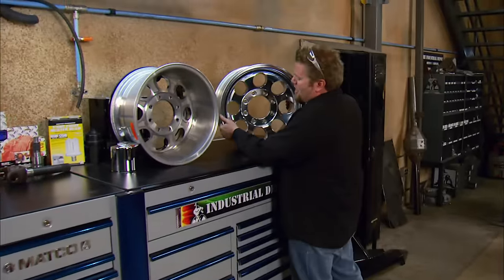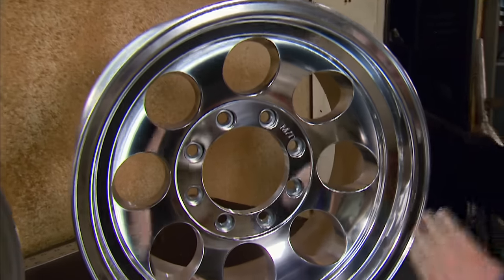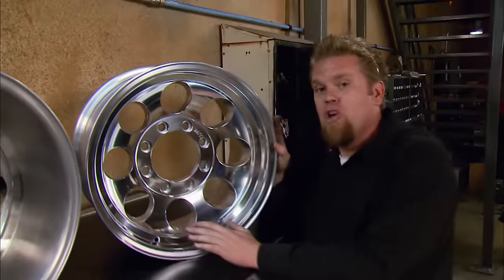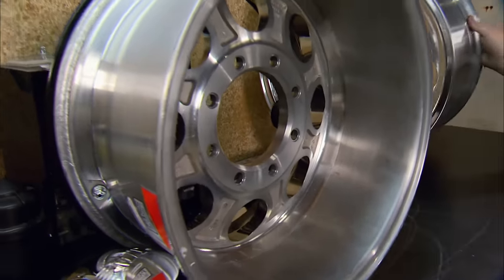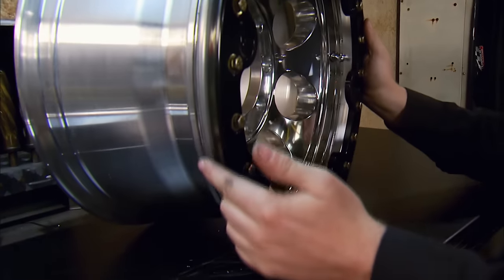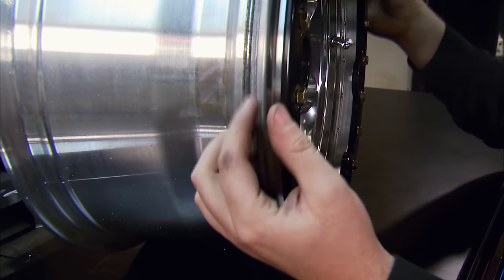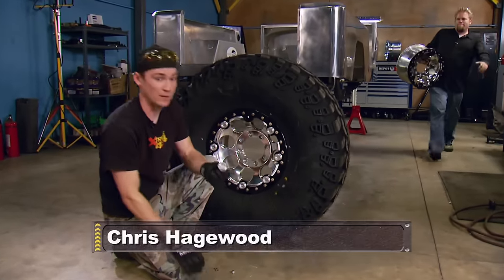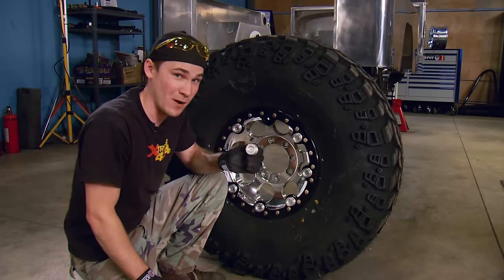The wheels we picked for this project are both classic in name as well as style — the Mickey Thompson Classic II aluminum wheel. This wheel design has been around for what seems like forever, and it truly is a timeless design. The high polished aluminum finish, heavy load rating, and steel inserts placed in the mounting flange make these wheels extremely strong. To make them even more capable off-road, we boxed them up and sent them out to Champion Beadlock, who cut the outer lip off and welded on one of their Rock Thrasher Beadlock kits. This will pinch the outer bead of the tire when it's aired down to keep it from coming off the rim. Champion also sent us a set of Rock Knobs — they'll protect the bolt heads on the trail, give side traction when you're pinned against rocks, and they look cool.